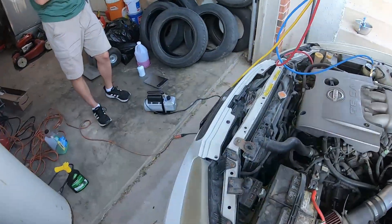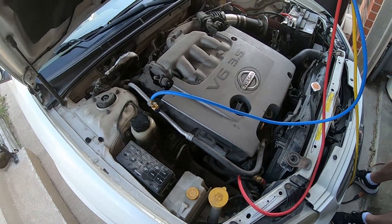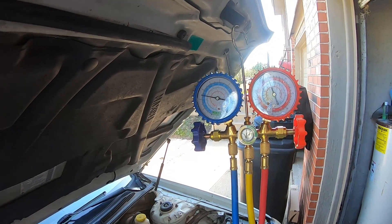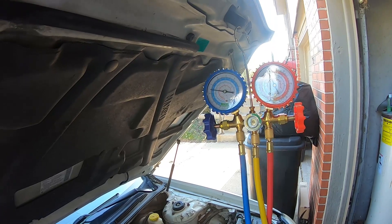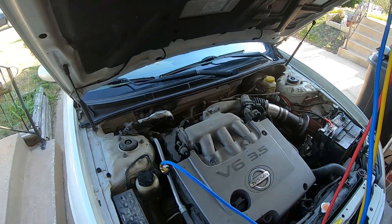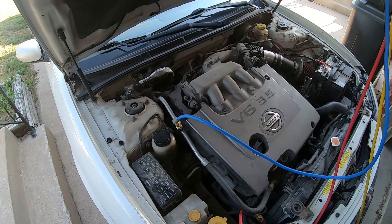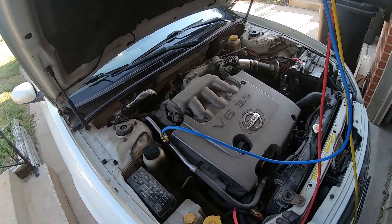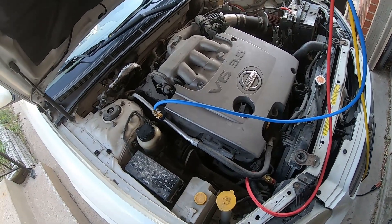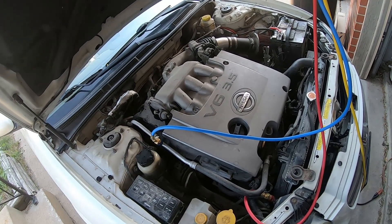At idle it's got a decent temperature coming out of the vents. I'm going to leave it like this — I want to monitor it over the next few days. I don't want to overcharge; I'm leaving at least 10 to 15 pounds of overhead for expansion when he's out in the sun or on the highway. The vacuum held well over an hour. I re-vacuumed it again after putting the receiver dryer on, and then we had to run for adapters for the gauge set — that took time — and it held vacuum the entire way.